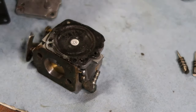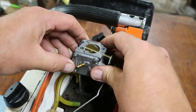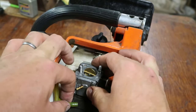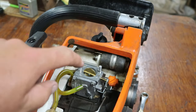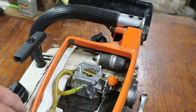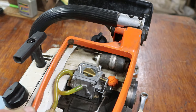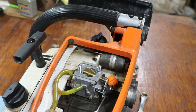Put the screws back on and tighten them. Put the throttle linkage back on, get it over the posts, slide it down, put on one fuel line, then the other fuel line, and it's ready to go. This may look intimidating, but on small engines this is almost an annual activity — do it every spring, because if it's been sitting over the winter with gas in it, it's going to run like garbage. Take it apart, clean it, and put it back together — it should only take about 30 minutes.